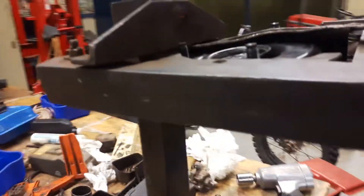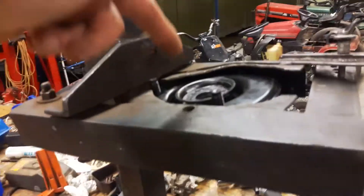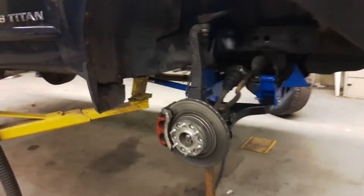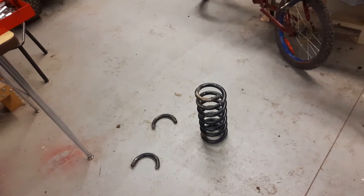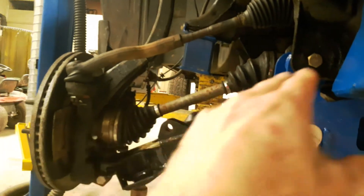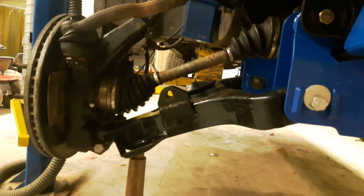You cut these with just a regular cutting wheel — do not use a torch. I use a Moog spring compressor; it works great, you just connect it to your top plate and it compresses the spring super easy. The other side is all assembled already; I'm working on the passenger side. I've got to change out these upper control arms, and once that's all together I'll drop it and see if the height has improved. I found that sitting level on the ground after the lift was installed, these CV axles were way too pitched and I didn't like that — that's the reason I wanted a proper suspension lift to begin with.